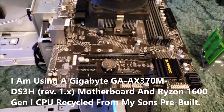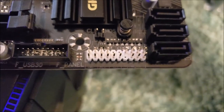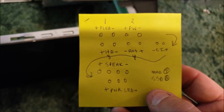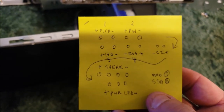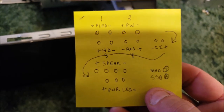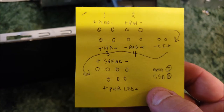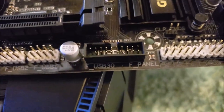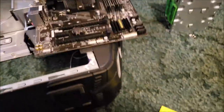A tip on your motherboard: when you go to hook up the panel connections, you may want to make a note of them or take a picture before you install the motherboard. The first eight pins are your primary pins that most systems are going to use, and the rest are usually for other accessories. It's really hard to see those labels once the motherboard is installed.